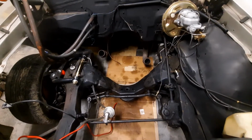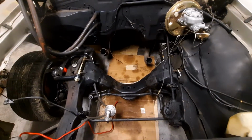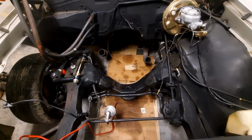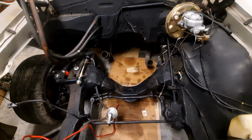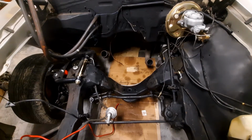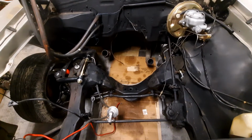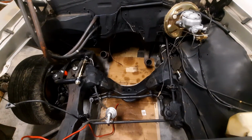First things first, that motor from where it's at, I think some of the old gas started sticking some of the intake valves, so we got something totally crazy going in here. We got a hydraulic roller, one-piece rear main seal block, 30 over, forged pistons, forged rods, forged crank going in it. I got a set of aluminum heads. We are going to run the cross ram intake on it, so it's going to be pretty wicked.